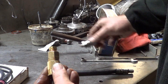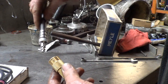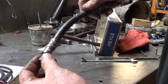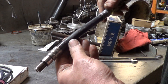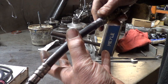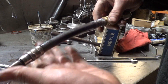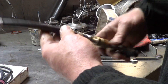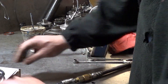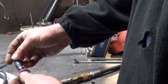There's the fitting in place, and there's the transducer screwed into that, and that fits into my compression gauge hose, which screws into the cylinder. I've heard that having a rubber hose here might flex a little bit and affect your readings, but if you compare it to a known good using the same tool, then it's a non-issue. I'll get some wrenches to tighten this up. Our next challenge is going to be getting our wiring to our transducer to hook to our Pico.